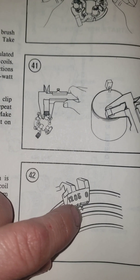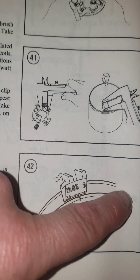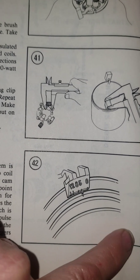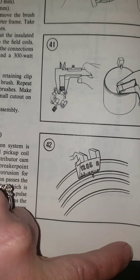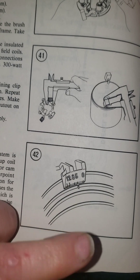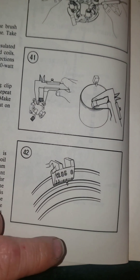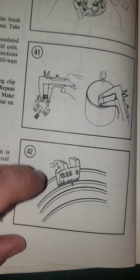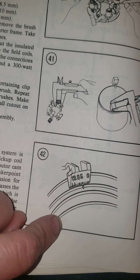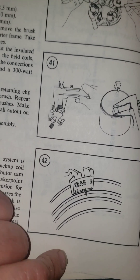If you can't see the notch when you first look down, just kind of follow the edge around and see if you can find it. If you can't see it from the top, get under the truck and look from the underside. If you can't see it from either direction, just put a 19mm socket on your crank bolt and turn counterclockwise until you find it, then mark it with your paint pen. It doesn't have to be lined up with anything.